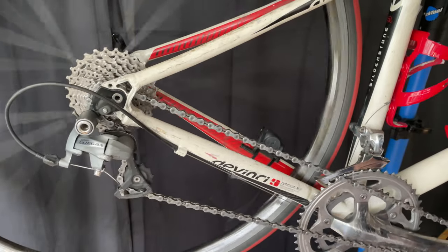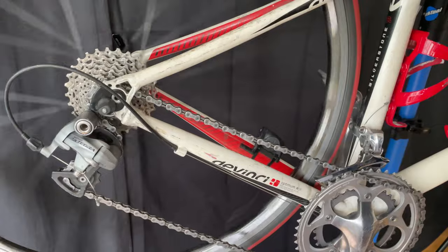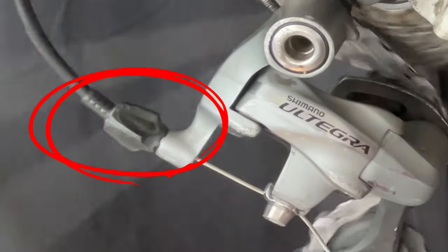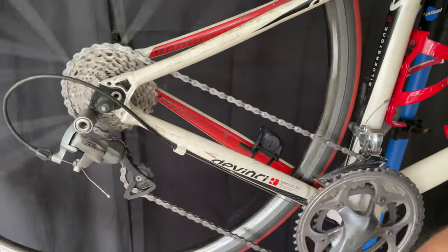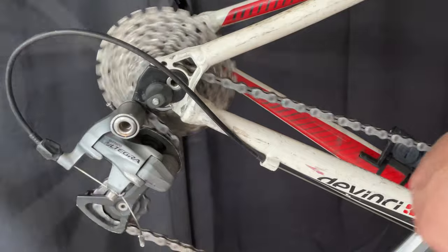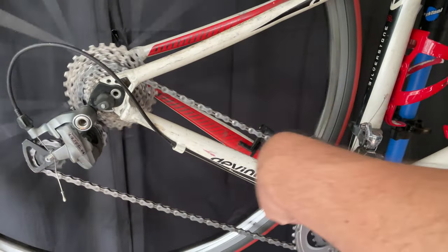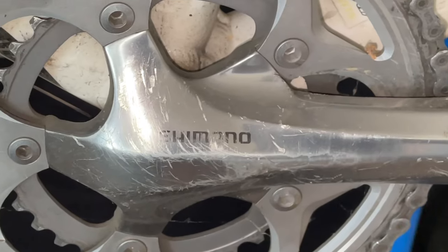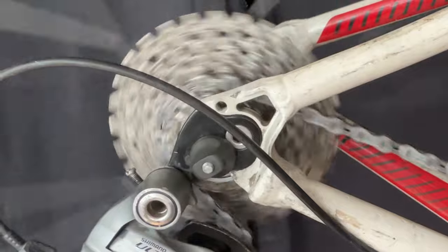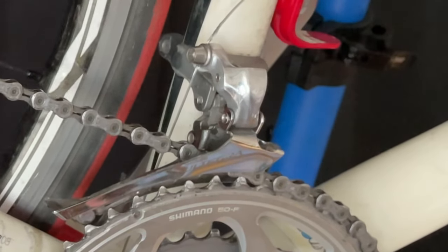On my first shift I dropped the chain, so we had to do a little adjusting. I adjusted the rear derailleur using the barrel adjuster — I turned it all the way in for minimum tension and retightened the cable. That was perfectly fine. There are some parts of this bike that are almost new and others that gave some trouble, but really the drivetrain is almost like new. The chain jumps up and down very nicely and smooth, and the front derailleur is working properly.